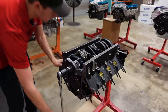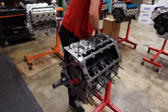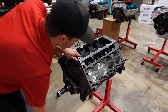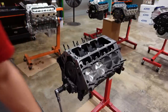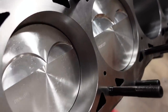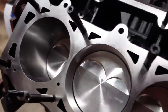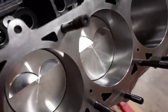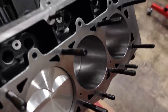The short block is now complete — it's assembled and spins over super smooth. Let's flip it over and take a look on top. Check out those pistons looking sweet. The rings are in this motor and look how clean the cylinder walls look. A lot of that is thanks to the plateau hone that we use with our Rottler H85AX — super crazy good surface finish, no burrs anywhere, and the rings are leaving no marks on the cylinders.